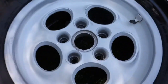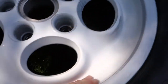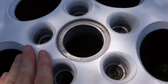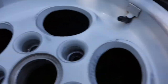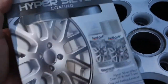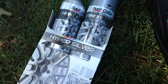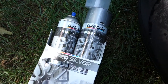I got done sanding it with both the 240 and the 400 — looks pretty good, and more importantly it feels pretty good. I couldn't film all the sanding while I was doing it. I took the center cap out and I'm going to paint it separately so I can get a nice edge. You can see there's a little burn-through on the white — I'm assuming this wheel was silver before, so I'm not too worried about that. I'm using the Dupli-Color Hyper Silver, which comes with a clear coat. I'm going to do four coats of silver and then two coats of clear coat, but first I've got to tape it off.